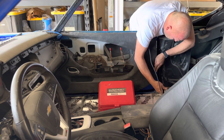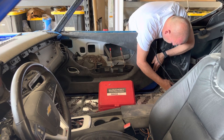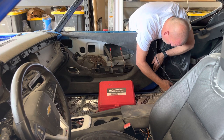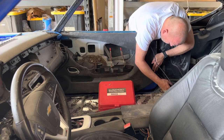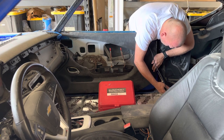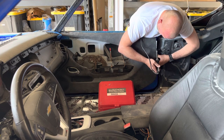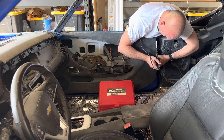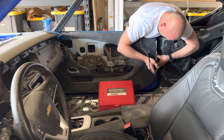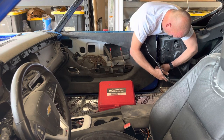So I hold this in place and weld the little plastic together. What I'm using is the plastic from the door and the plastic from the filler piece, just to create a weld here. After I get it tacked in place, I can go back and use the filler rod to create a proper weld. All I'm doing right now is tacking this in place, so when I bolt the door up, it'll all be together. The bottom part of the door already has a fixed position that I like. And this part here is mostly good. I just want to make it a little bit better.